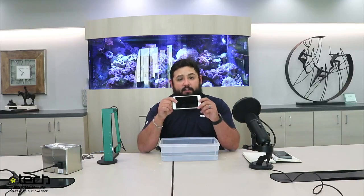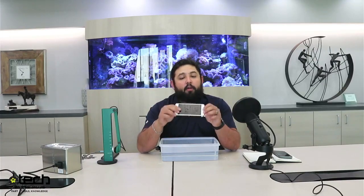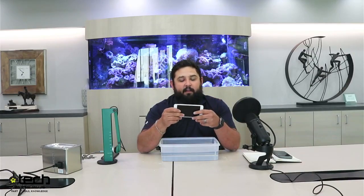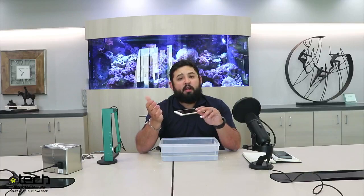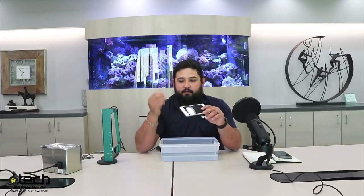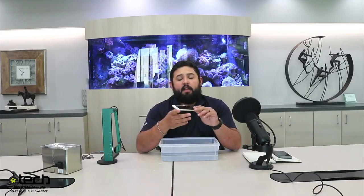Number one thing is turn the phone off if it's not already off. What causes the majority of board failure or just phone systematic failure is liquid between components, and it causes a short. So it'll basically make the phone turn off. Oops, I got some water in my hands. But basically, if you turn the phone off, you prevent that short from even being capable.